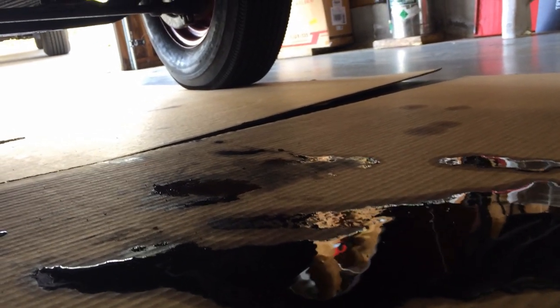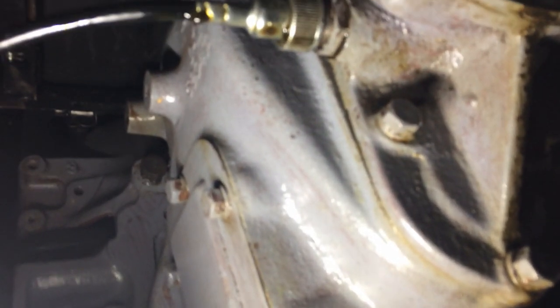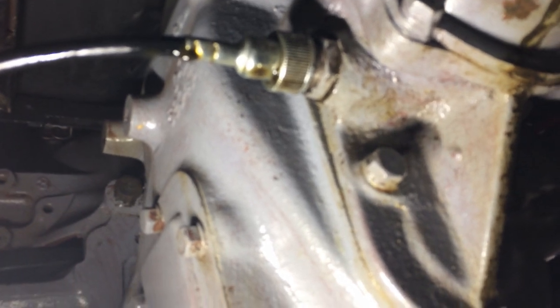I'll just walk in a little closer. See it there? That is right underneath the transmission. It looks like right under where I was screwing around the other day with the speedometer gear. So there I am now — I had to change gears, literally and figuratively. I put on my coveralls and crawled under the truck, and you can see that the speedometer cable is dripping. There's a big drop on it now, and right under that drop is where that puddle starts.